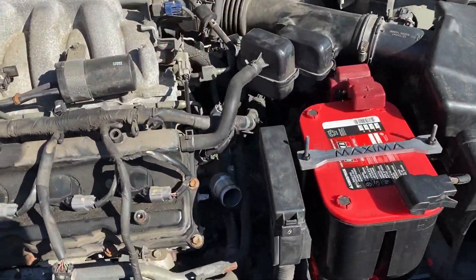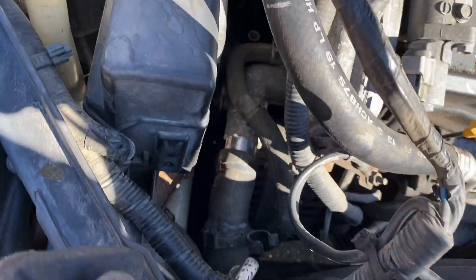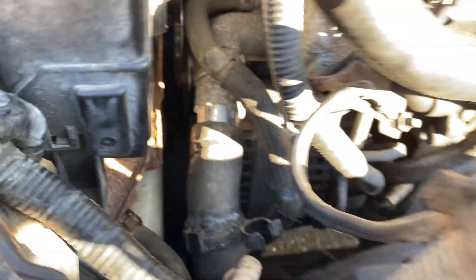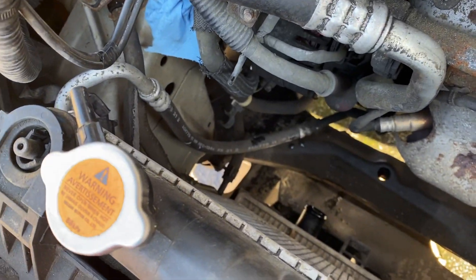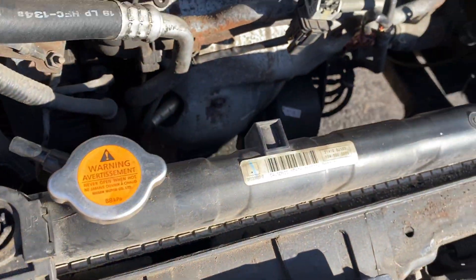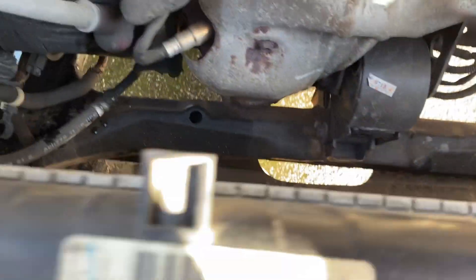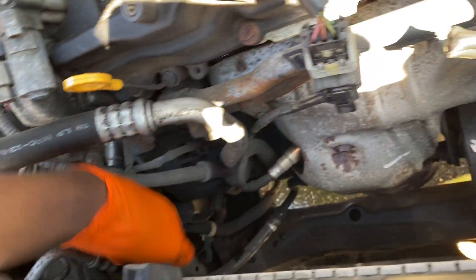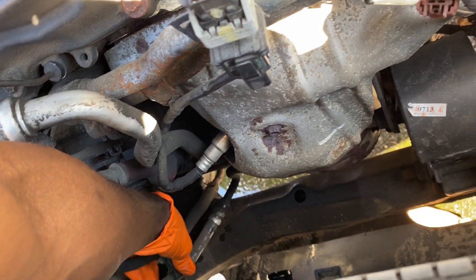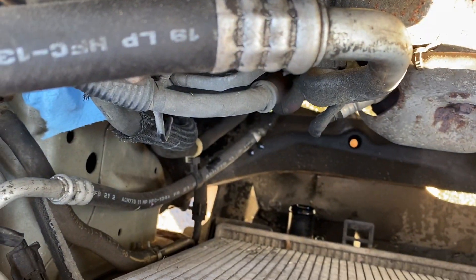Project Silver Surfer 2.0 in full effect! Upper radiator hose out, lower radiator hose disconnected — just gotta get the bottle portion off. Radiator fans missing — I like that. Getting this going right now. About to snatch this radiator out, clean up down here, check this motor mount, see how that looks, check these other plugs, and pretty much just keep everything nice and neat.